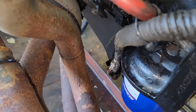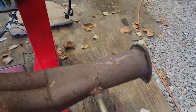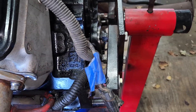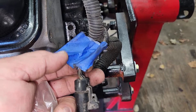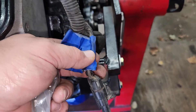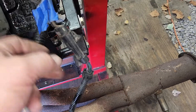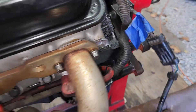Now off that harness that comes down, you've got your oil level sensor, your oil pressure sensor, then you've got your O2 sensor. If y'all watched the video when I was taking the motor out of the car, I had the back of the car on blocks so the exhaust tips didn't hit. And the motor rolled off the blocks and rolled forward, and the body pinched up against the motor and hurt some wires right there. So I'm going to have to fix that. This wire is too long anyway, so I'm just going to shorten it, take the plug off and just hard wire it in, because those are just for the extensions and it's not needed to have a plug there.